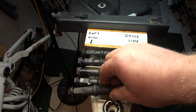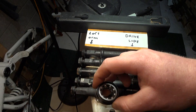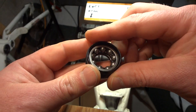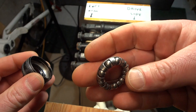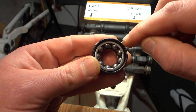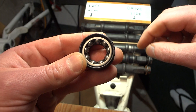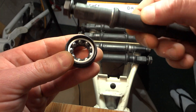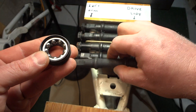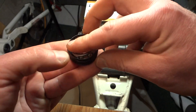Another thing is your bearings. If you're not sure which way they're supposed to go, the part that is the round part goes into the cup. And the side that has like a flat ring here — that's facing you, or into the race over here. So that's the way it's supposed to work. You can't put it backwards; it has to be like this.